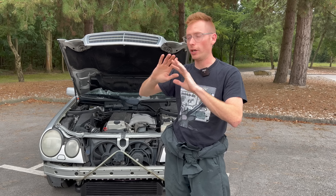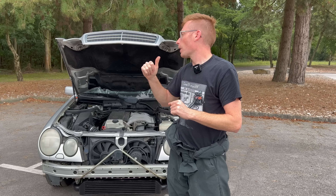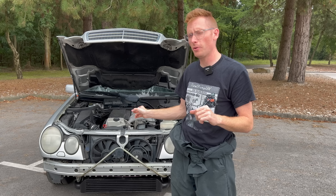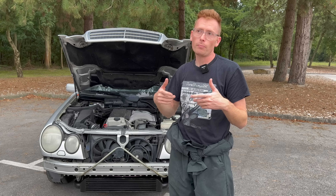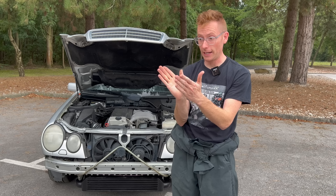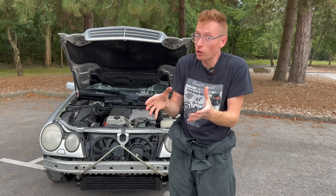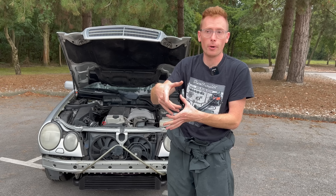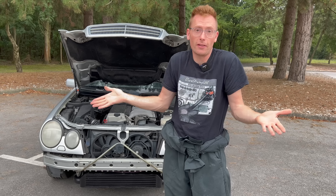So if you purchase our full 3-inch exhaust — which is all nicely made to fit your 210 saloon, just direct fit, no cutting, no nothing — and you decide you want to upgrade your turbo, even though the car is quite quick, it's easy. You can literally take that section off, just a standard 3-inch V-band to connect back to it and then to your new turbo. I can't make it any easier than that.